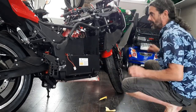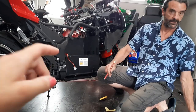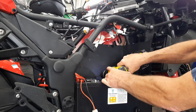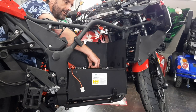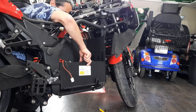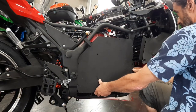You're going to take the bracket, lay it on the battery, and mark the spot where you want to drill a quarter-inch hole. We'll carry on from there. Set the other battery plate cover in place, then reach in and mark it. This comes with the bike and will have the bolts with it. We just need to snug it so it's not flopping around, then you can mark the other side with some accuracy — make sure your holes are lined up.